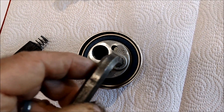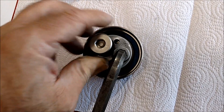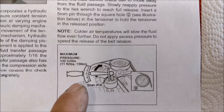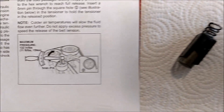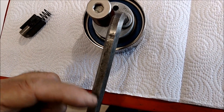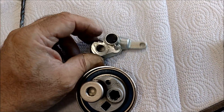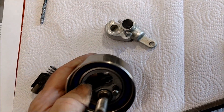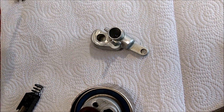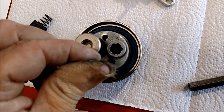When you do this on your motor, while it's still bolted down, when you go to release tension on this, you're just going to slowly pull back on it. It even says here: no more than 11 foot pounds or 15 newton meters if you're into the metric side of things. As you slowly rotate back, it will slowly roll back. As it rolls back, this pin is going to move away from this notch in this corner. When you get it far enough back, all the way to the fully seated position, you'll be able to drop the holding tool in the corner, then slowly release tension and let it get some grip on there.